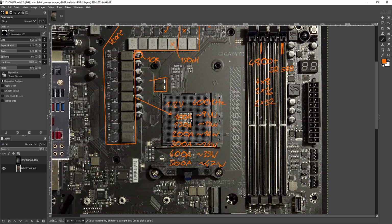Everybody else sort of stuck around with what they launched, though MSI launched with the first shielded topology, and for a while that was the best daisy chain you could get. And then Gigabyte came along with their shielded daisy chain, and this thing is so good. By far, if you're going for 4-DIMM motherboards, from what I've tested, it doesn't really get better. I honestly think that the new topology from ASRock and MSI probably just matches the Gigabyte one in terms of performance, because there's got to be an upper limit to how far you could push the memory. Though, unless I get to test those boards, it's hard to say for sure.